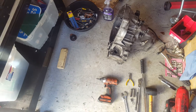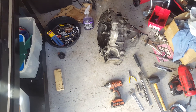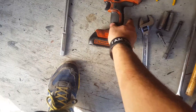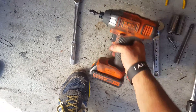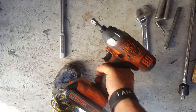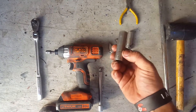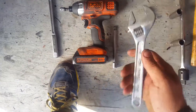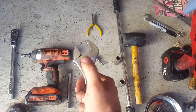Hey there YouTube, we're back today with another video. Today we're going to be taking off the casing of a B-series transmission. We'll go over the tools we're going to need. You can either use a ratchet or an impact driver — in my case I have a Black and Decker one, not as good as the DeWalt in my personal opinion, but it works. I use a three-eighths drive, an extension, a 12 millimeter socket, and a 14 millimeter socket. You're also going to need either a large wrench or an adjustable — I like to use an adjustable.